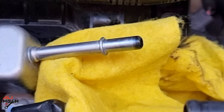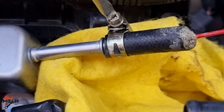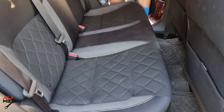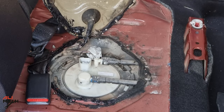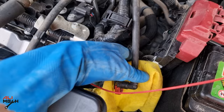Now let's get back to the fuel rail. Inserting the DIY adapter — the one I showed you how to make — and then clamp it down. The next step is to disable the fuel pump from running and pumping gas. You can either disconnect the wire harness like me or pull the fuel pump fuse out. Note that for some cars when you pull the fuel pump fuse, the engine won't run because the same fuse is responsible for some electronics of the engine. Alright, the fuel pump is disconnected.